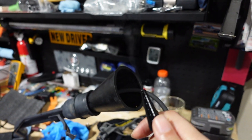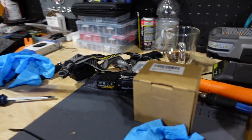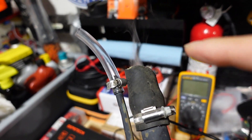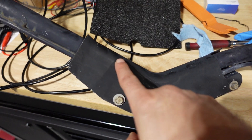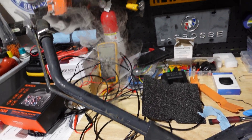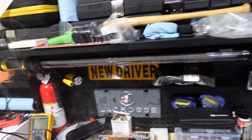The cone is connected and once the smoke comes out we're going to evaluate the gas pipe. If you watched the last video, smoke was coming out from here and here, which means there was corrosion that caused this pipe to rust out. Now smoke is coming out of the end - that's what we want to see. That means the gas pipe part is good.